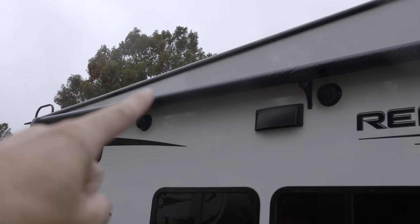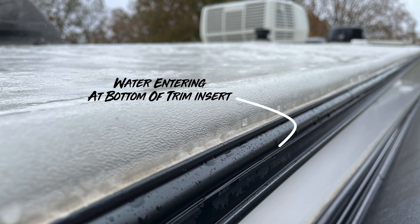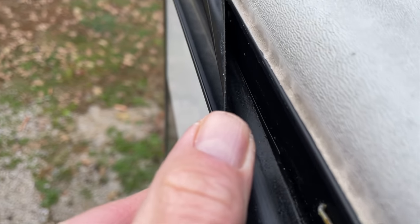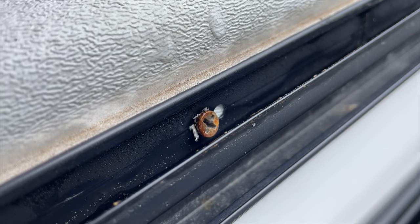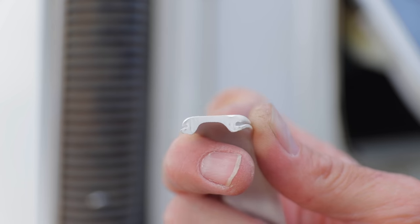If you see that trim along the side of the RV — we replaced this on our last RV and I'm going to do the same on this — that trim insert on that metal piece of trim bridges between the roof and the sidewall. It allows water to run down the edge and over the trim piece, and there's really nothing that stops it from running inside that track because that trim insert just leads water right in there. As you pull that insert off, you can see there's quite a bit of moisture back inside. What I plan to do is pull those screws out just slightly, put a little caulking behind there, put it back in so that each screw is sealed, and then get a trim insert that has more of a groove so it overlaps on the outside on the top and bottom, creating a better seal.